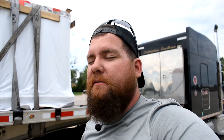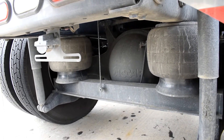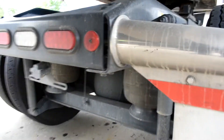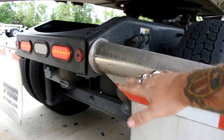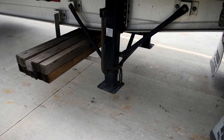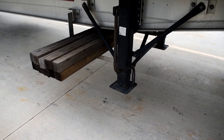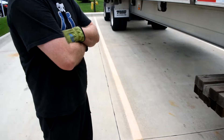Now he's gonna lower the landing gear, because if you just pull out at this point your trailer is gonna hit the ground — and then you'll be sitting there for an hour cranking it back up. With our TMC trailers, you can dump the airbags in the truck, which lowers the air ride suspension. When he lowers the landing gear, he's going to leave one to two inches between the bottom of the landing gear and the ground, and I'll show you what that does in a moment.